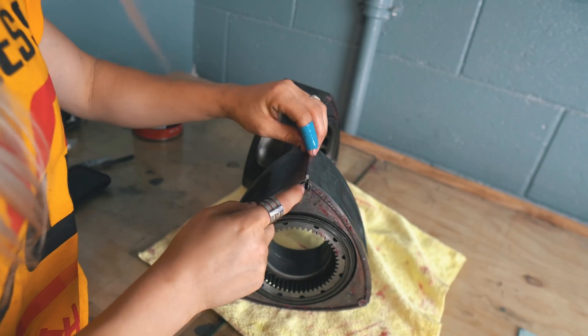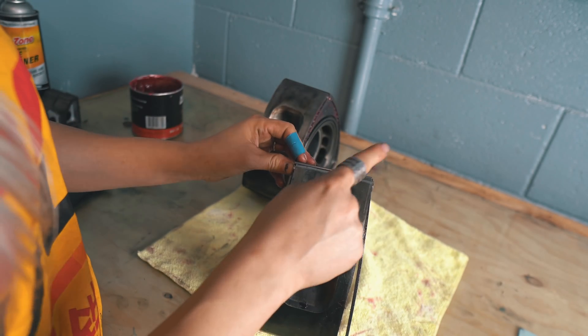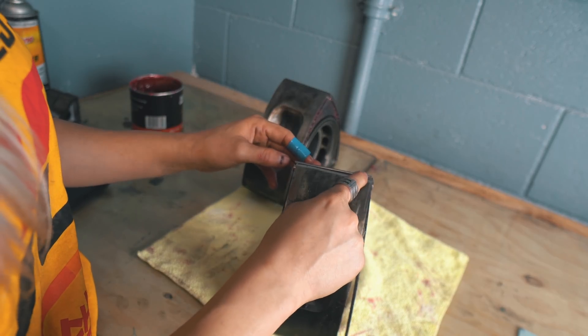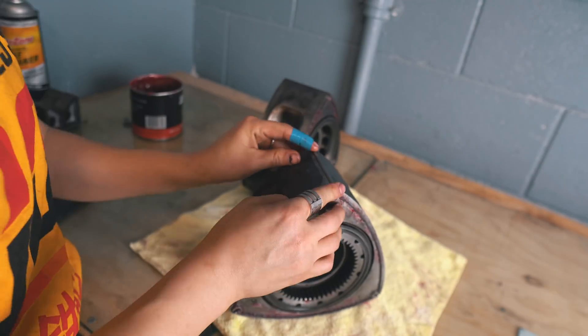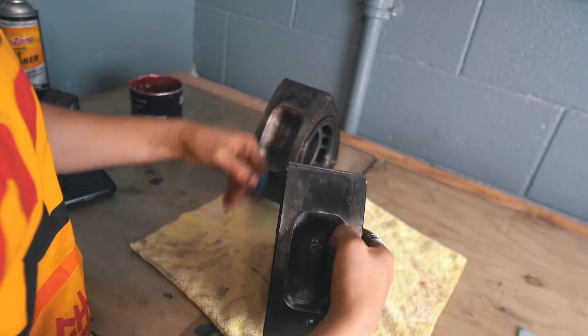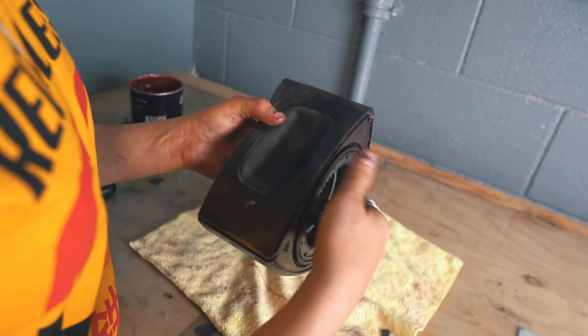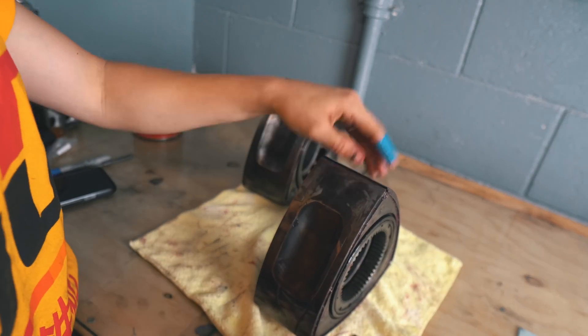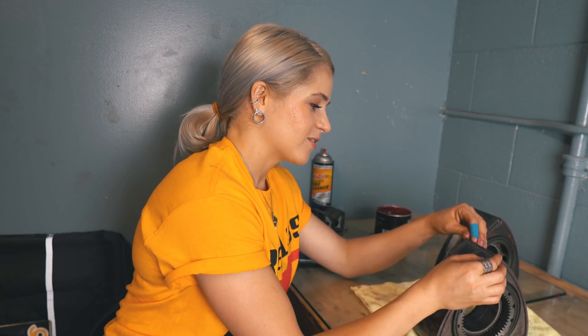The second rotor is not good — it goes down on one side but it's getting caught on the other side. There's tension kind of all the way across, mostly on one side. Unfortunately, I'm going to have to file this one. This side is really tight too — you can see when I'm pressing on it, it's fighting me. So I'm going to have to file this one down as well. The first rotor was great, the 3mm just went straight in. This rotor, however, is struggling hard — pretty much every side for the apex seal spot needs to be filed out.